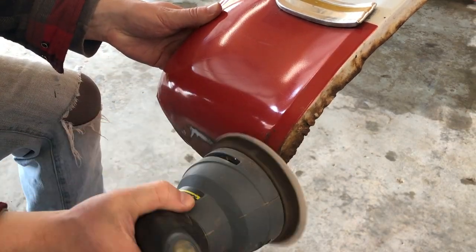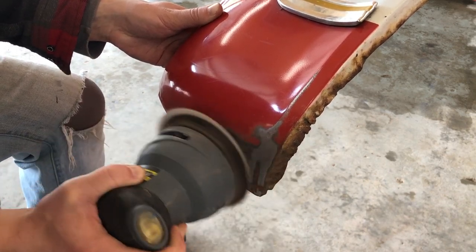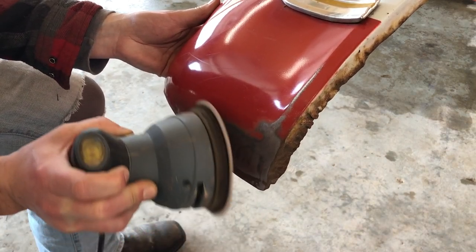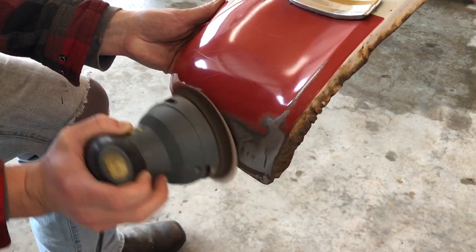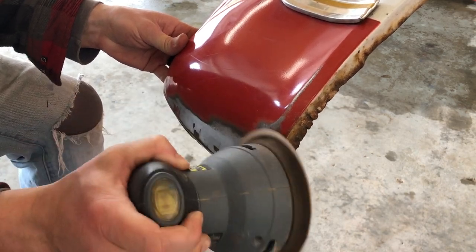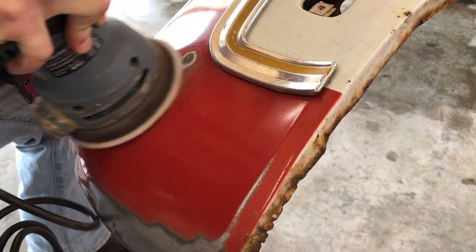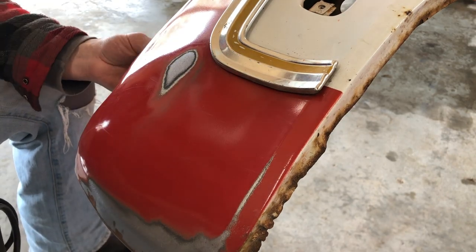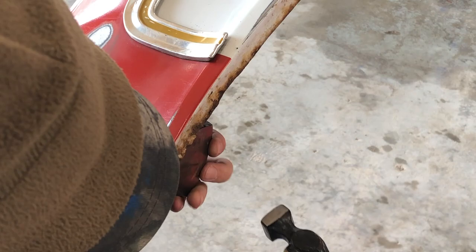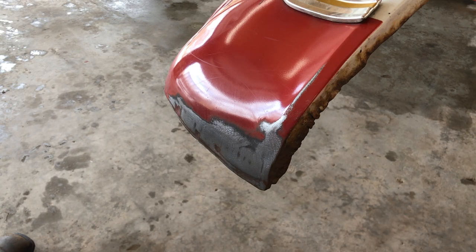While I'm waiting for that primer to dry, I'll get rid of some of this random surface rust around different parts of the fender, and use a dolly and a hammer to try and fix some of these imperfections around the wheel arch. A lot of the crinkles you see in the front of the wheel arch are from the factory, where they had folded the sheet metal over, and so we're not going to be able to really fix that because that's how it came from the factory in 1976. But we can at least make it look a little bit better. All I'm using for this is a DA sander and 60 grit sandpaper. Depending on the severity of the rust, I'll either use coarser or finer grit. As we're going along, you'll be able to see some high spots and low spots in the bodywork, and that's a good place where we can use a little bit of filler and practice feathering, where it's on the bottom of the fender and not very noticeable.